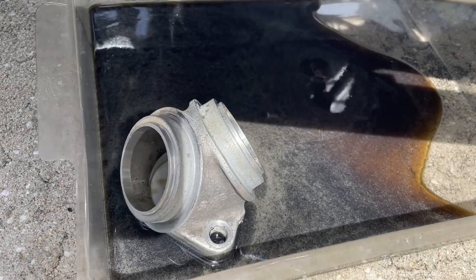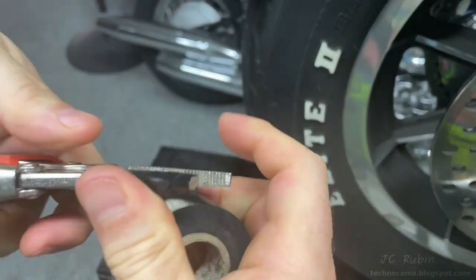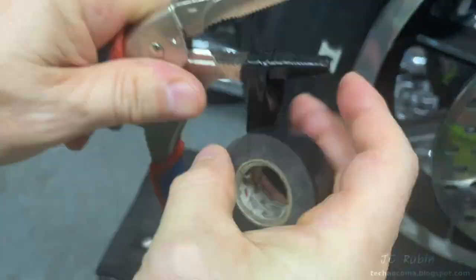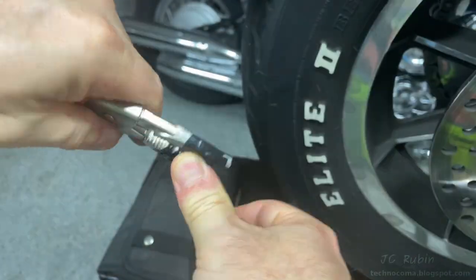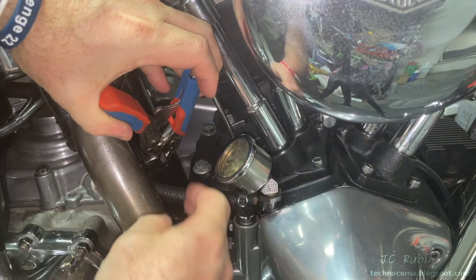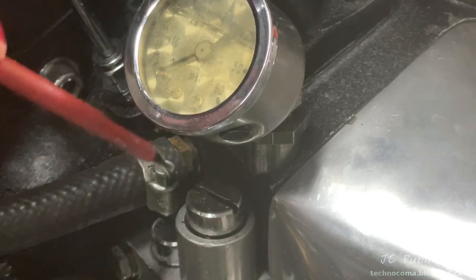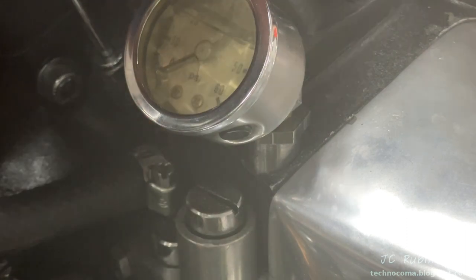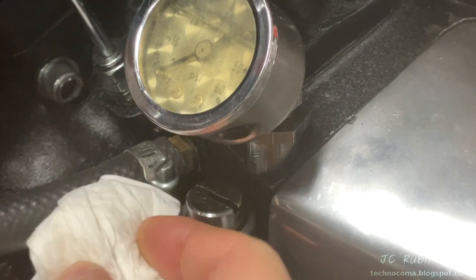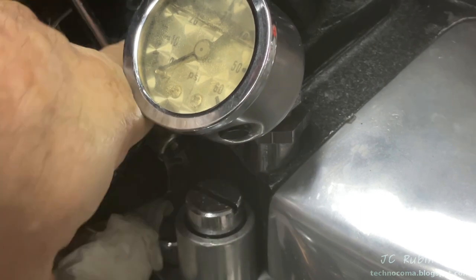What you see in the oil is actually thousands of tiny air bubbles — it's not any contamination. I'll be needing a pair of vice grips to clamp down on the oil line going into the pump, but I don't want to mar the hose, so I'm going to give it a couple of coats of electrical tape on each side of the teeth. I've got it on the hose coming from the bottom of the oil tank and I lock it into place. This hose clamp is obstructing, so I have to loosen it and push it out of the way, and I'll preemptively stuff some paper towel under here just in case.